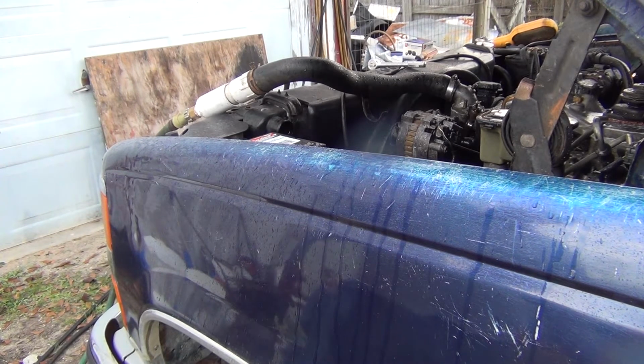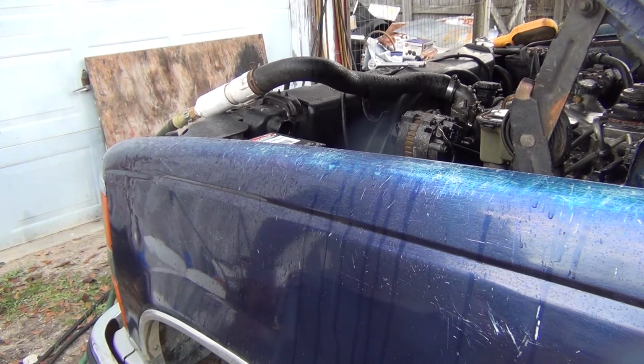In order to get the mixture at a 50-50, which is what I'm looking for, even though I'm in North Carolina and really don't need it, I got to put a little over 3 gallons of coolant, concentrated coolant, not 50-50, because yeah, it holds over 6 gallons of coolant in this diesel that everybody bad talks so much.